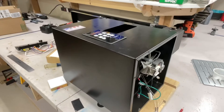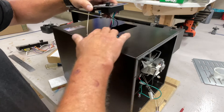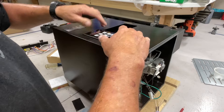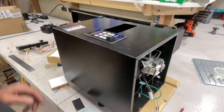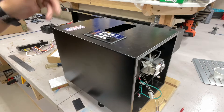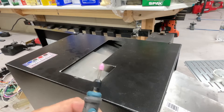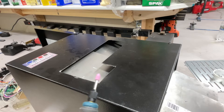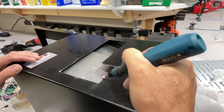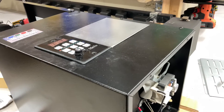It fits and overlaps in there pretty nicely — there's your hole right there. I'm breaking all these corners with a grinder so there are no sharp edges to catch any wires. Then we'll work on our filler piece to fill in the gap. Looking at it more, I may put the filler piece on the inside and just rivet it in place — that'll probably be the easiest approach. I just did a review on this little cordless Dremel this week, and here's exactly what I'm using it for: breaking these edges.